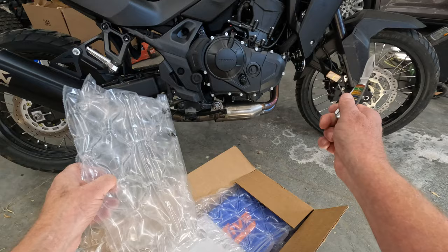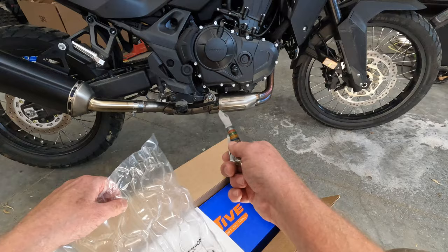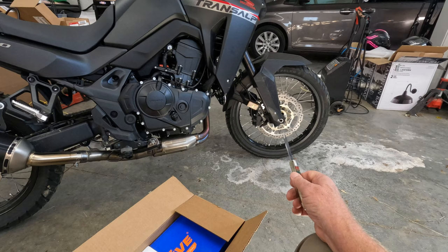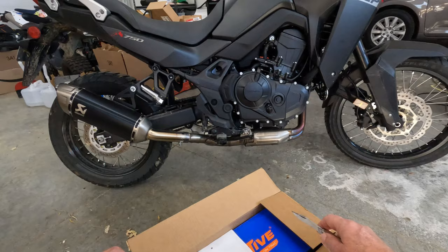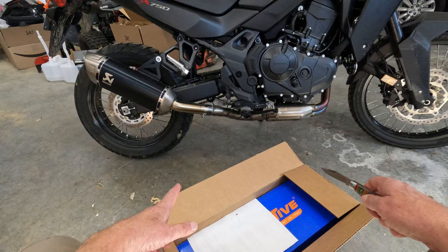This is 200 millimeters up front and 190 millimeters on the rear, they say. I flow through it pretty good. I'm not finding any problem really with the forks. I did have to crank up the preload a little bit. It could be better, but right now we're trying to find what it should be. For my weight, I travel through that suspension too hard. So I got a plus 25 millimeter — well, it's almost an inch, like 980 thousandths of an inch. So this is going to come up an inch more.